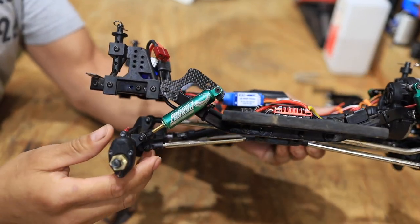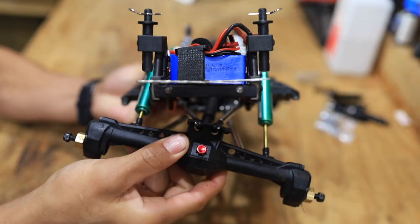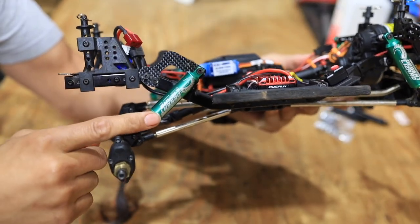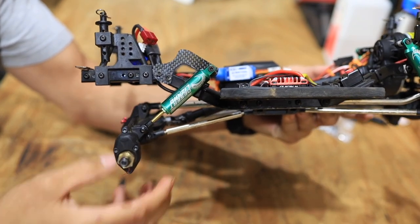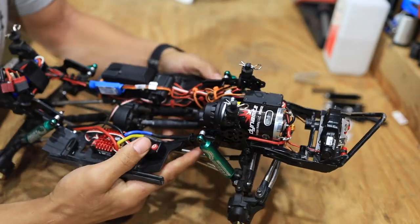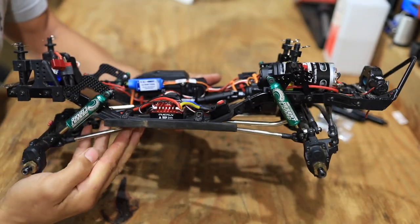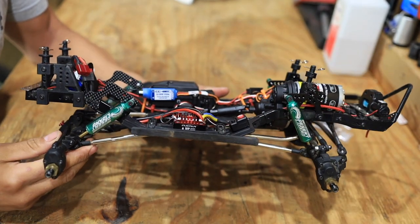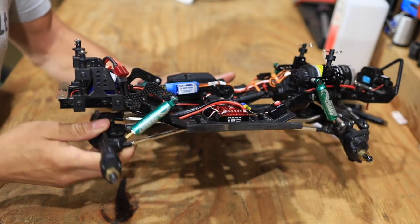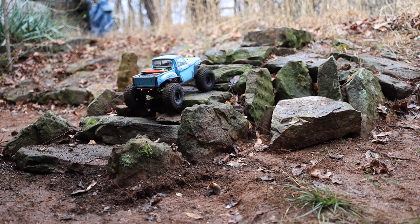Since I have switched to the tomahawks in the rear, it's helped out tremendously — you can see the rear here is already drooping down. There's almost too much free movement in here, especially while I'm side climbing and just not enough resistance. Now I'm running about 47.5 shock oil on the Desert Lizards with the medium springs right now on the internals. The RGT is so top heavy — the center of gravity on this thing is pretty bad. We've got the servo and the motor mount up high, so anytime I start to tilt over I usually end up toppling completely over just because of the weight being up so high and the rear wanting to move all over the place. I love the articulation on flat stuff and when I'm climbing straight up, but the side climbing is just a big issue.